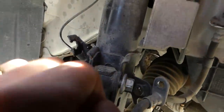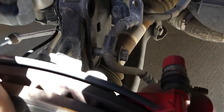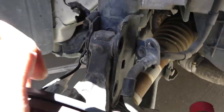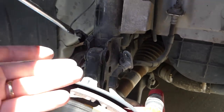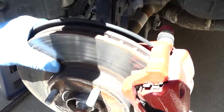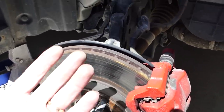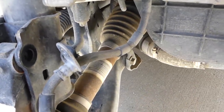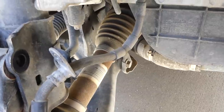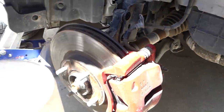Now we need to move the hub a little bit and wiggle the bolts out. Once you disconnect the last bolt, the hub might fall, so put a bucket or something underneath to support it. If you don't support it, when you remove the strut it will pull the CV axle out of the inner boot — and that's a real pain to put back together. You may even need to remove the boot and deal with all that grease.